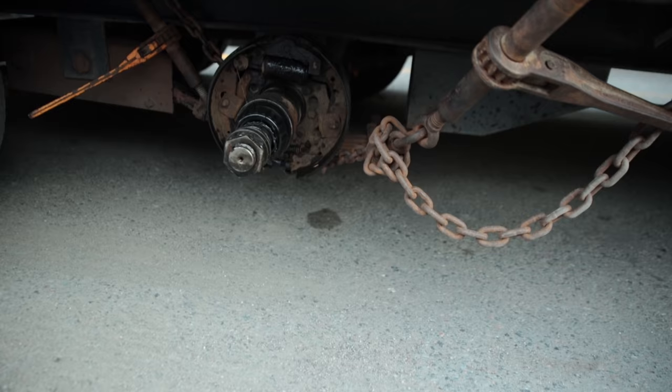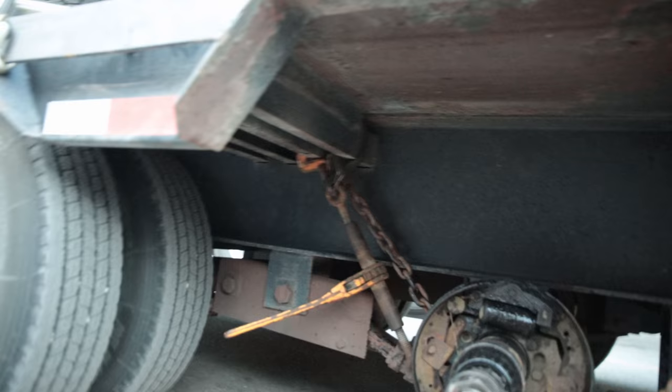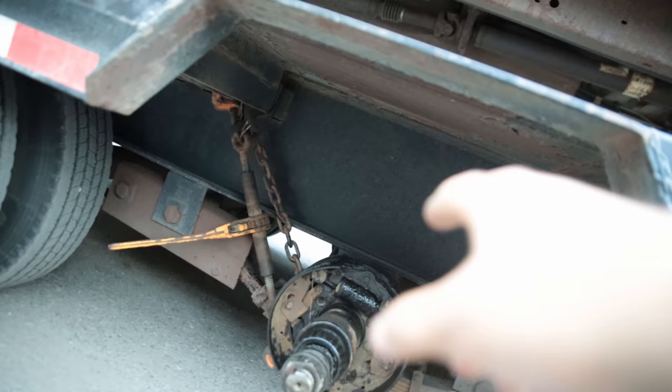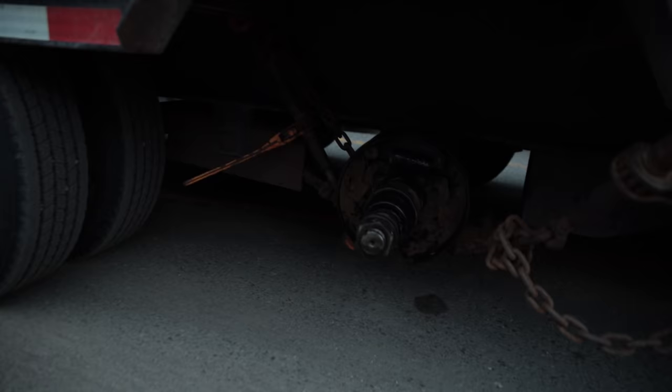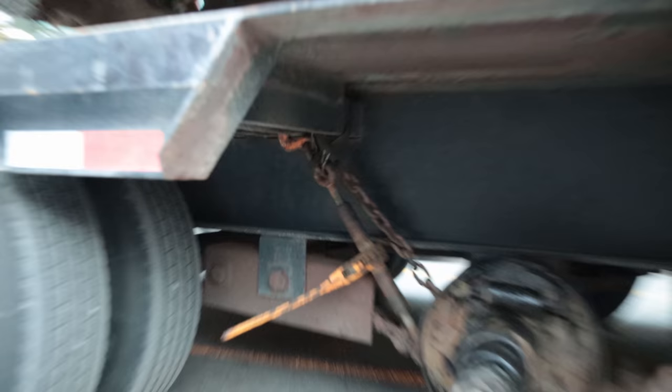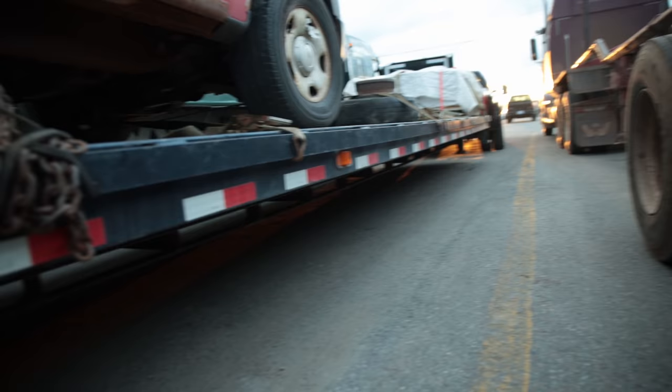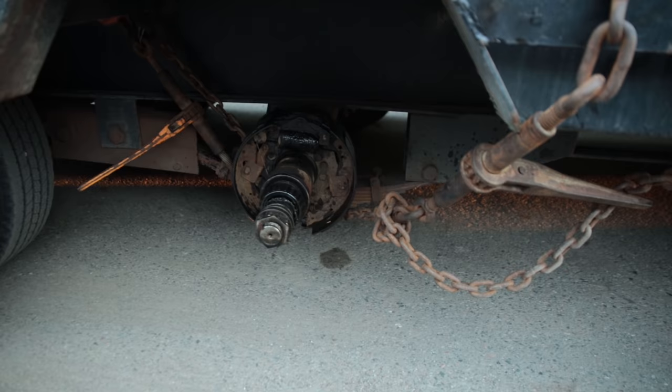At first I just had this chain here. It would have been better to put it onto the rub rails. Sometimes there are places underneath the trailer to hook a chain — my old trailer had great places where you could tie it up around the I-beam, which was always nice. But on this one the I-beam comes flush — that's not going to work. So I just have it hooked onto a cross member, which is probably a dumb idea but it seems to be working. Usually the proper procedure: first loosen your lug nuts. In this case I took the whole hub off because there was just nothing holding the hub onto the axle anymore.